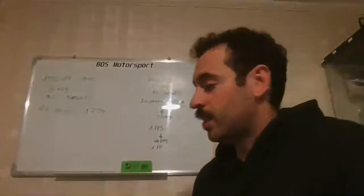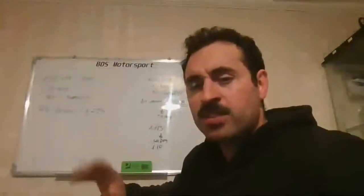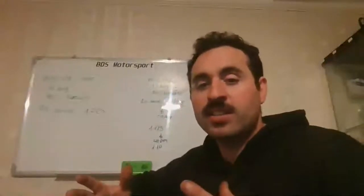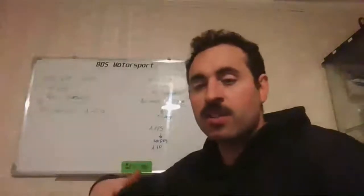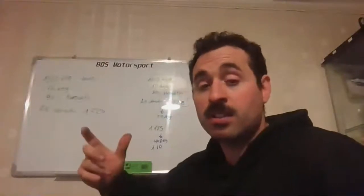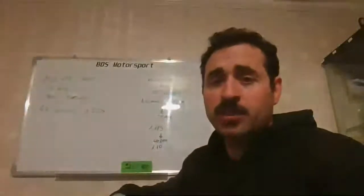So in here, we've got just a few examples. This is quick. I put everything within the same numbers. The only thing I've changed was the humidity. So you guys see the effect humidity has and how far you have to go on humidity to actually make a small difference. And with temperature, you see how much smaller a change in temperature makes how much bigger a difference in density. So let's start with the typical condition in the UK.